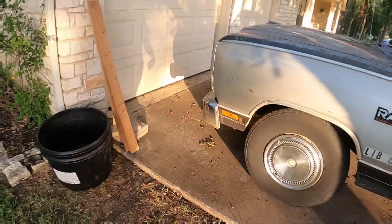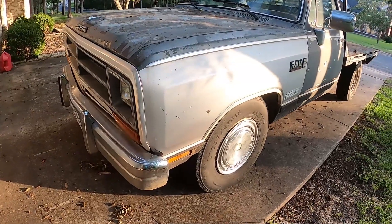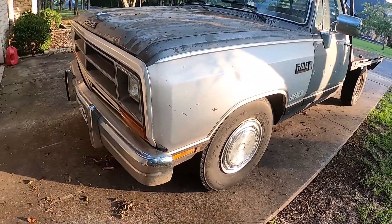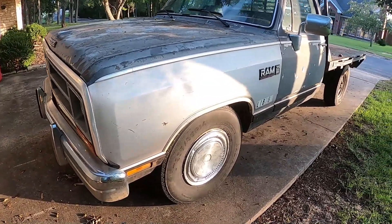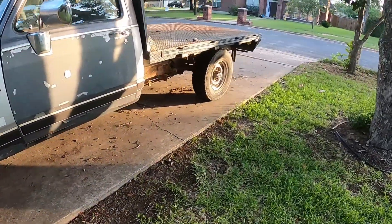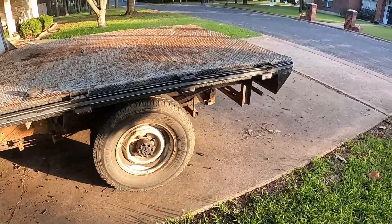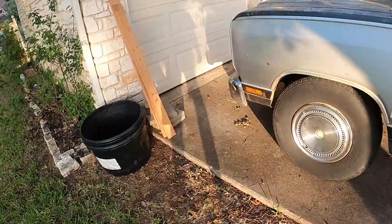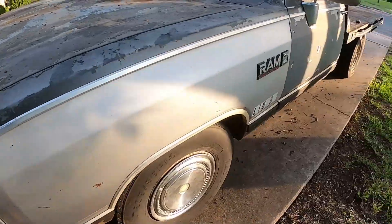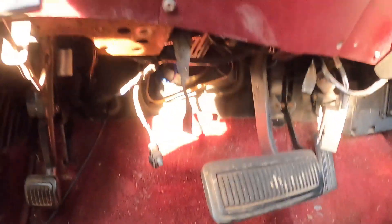So let's get into the Dodge and see if we can fix the blinkers. One thing we always want to check before diving into anything more major when troubleshooting is check your bulbs, because the bulbs in the blinker system will throw the whole system off. They're designed to hyper-flash - that's when it blinks really fast - whenever a bulb goes out. Make sure you don't have a bulb out in the blinker system, including rear ones and even your side marker lights.